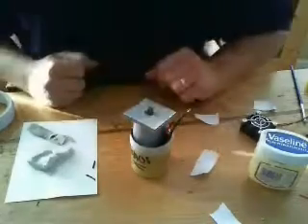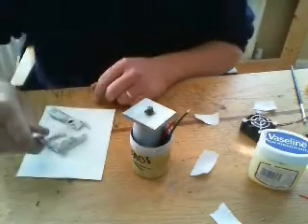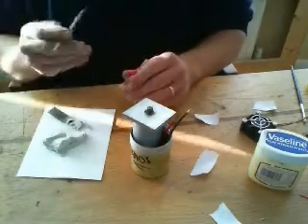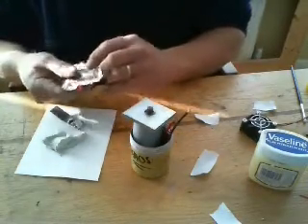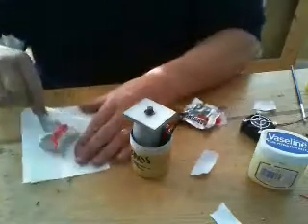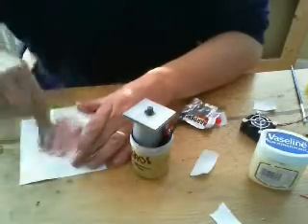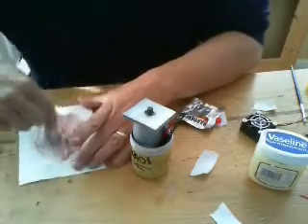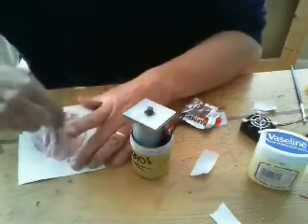Now I've just jammed that into a little cup there to help me work on it. The instructions give directions on how much to mix, and it's usually apparently a pea to a grape. To be honest it's not that crucial — what it affects is the setting time. So if you use too much of this red hardener the setting time is really quite quick, and if you use too little it takes forever to set. So that will be enough. Once you've got the hardener in there you need to mix it thoroughly, getting all the little streaks out so the whole thing becomes a pinkish colour throughout with none of the grey streaks still showing.